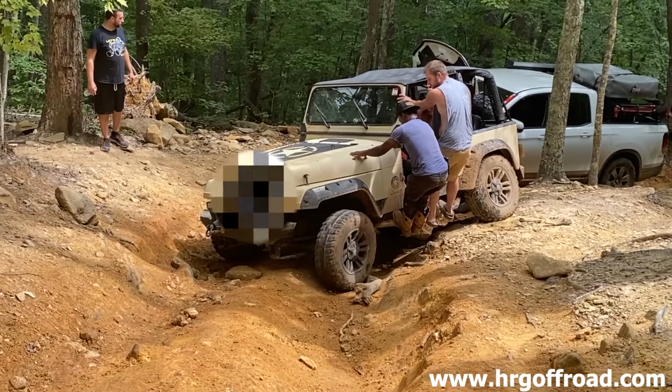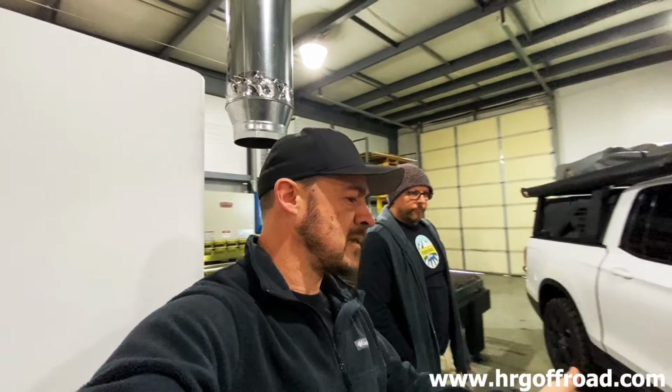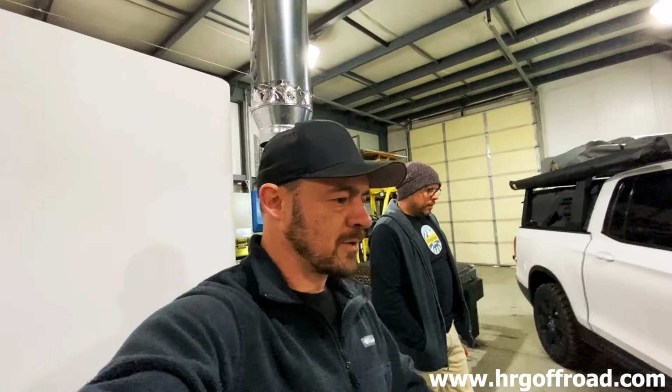If you think about a Jeep or any other normal off-roader, that's the same. They have the same thing. In a Jeep, you've got a solid axle, and the pumpkin on the center section of the axle still hangs down no matter what lift you put on. One of the strong suits that independent suspension vehicles have is clearance under the car because you don't have that center diff on the solid axle hanging down. So there you go. That's the upside for doing a 2.5.